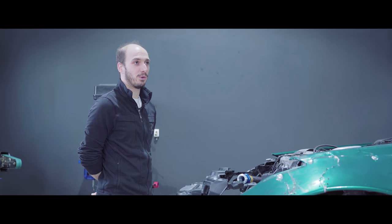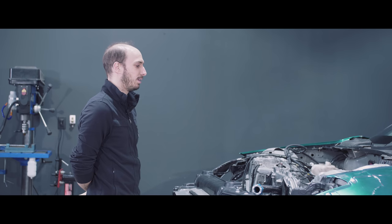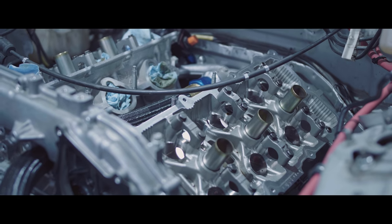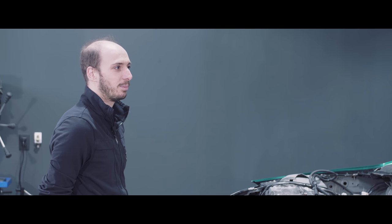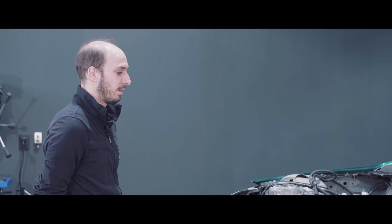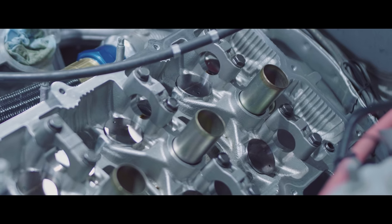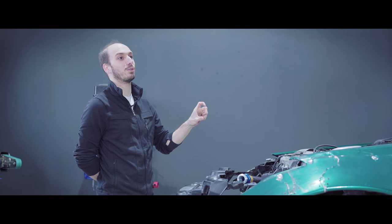It's getting a new engine. The old engine was actually quite stock — it just had pistons and cams effectively. This new engine is going to be arguably the most advanced VQ in the world. It's going to have a Bryant crankshaft, which is going to raise the displacement to 4.2 liters, a compression ratio well over 13 to 1, and the pistons are only going to have two rings instead of three to reduce friction. The heads are ported, and it's got custom camshafts done by Jim Wolf Technology that actually require us to machine the heads and install larger lifter buckets, because the cam is so aggressive that if you don't have bigger buckets, it will literally ride off the edge of the bucket.